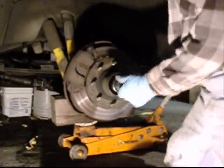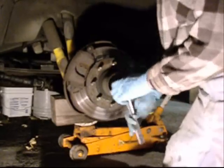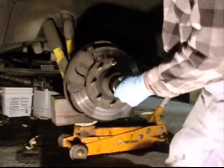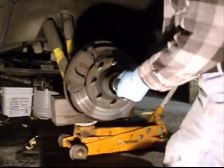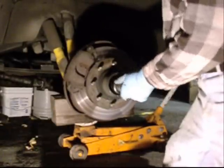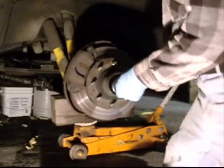I haven't taken off the inner nut to see if it has the pin because I have a problem. Turn it to go and engage the four teeth and then it ain't coming off. The hub is mangled. And I don't know why it was one turn loose. But that should have absolutely no effect whatsoever on the threads. Those threads are good. Now my bearing is totally tight — I'll loosen it off and tighten it again. It's finger tight, back off just a little bit.